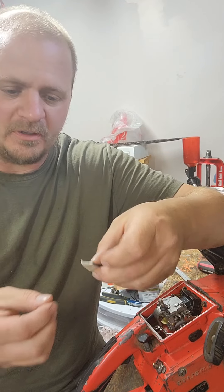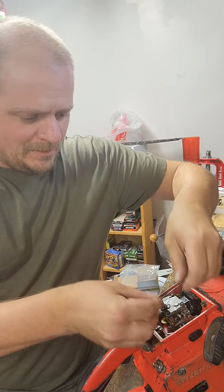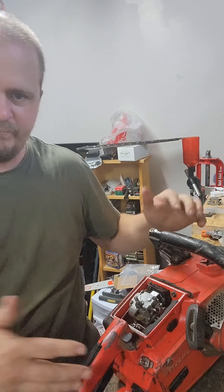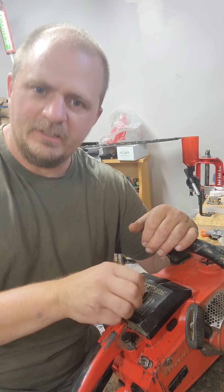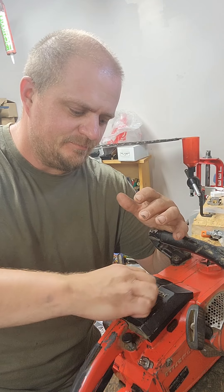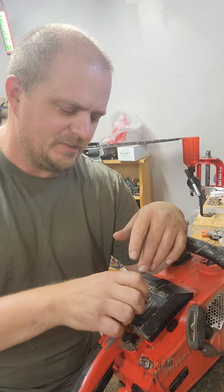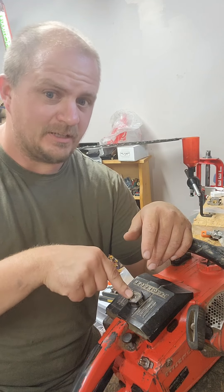If I was actually doing this to the saw today I'd cut it to the right length. But just peel it and cut it down along that little ridge there — you see that little line? Put it all along there and along the top, then put the filter over top. You'll be able to feel the difference, because as the nut goes down you can feel it tightening and compressing that neoprene gasket. Also your cover won't rattle around, because on some of these saws the old gasket won't compress so there's no upward tension, and the cover will actually rattle loose — which makes things even worse.